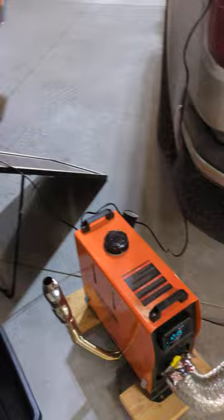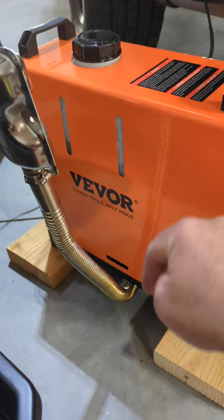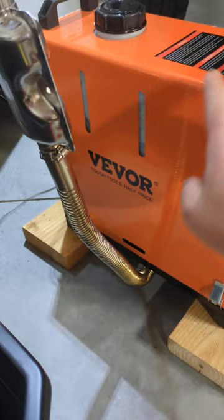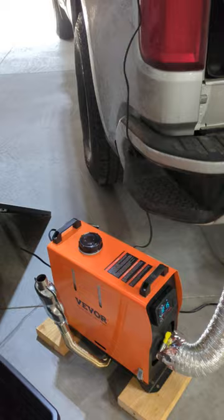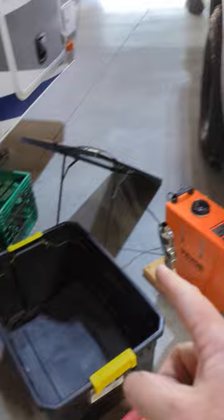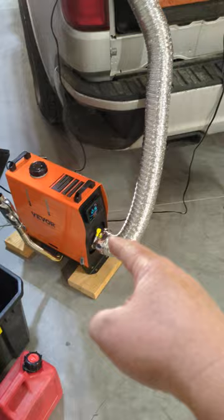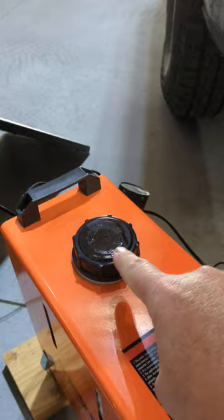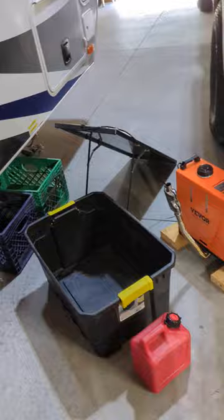The exhaust system — I wasn't really a fan of. I don't like the look of these blocks I had to put under it, but the way they manufactured it, the exhaust port points straight down and there's not enough clearance to 90 it and kick it up. I didn't want the heat too close to the diesel container and I wanted to be able to take the cover off. This is about the best I could do aesthetically. When camping, it's actually kind of stable because everything fits inside this crate. When we travel, I put the unit in here with the diesel tank, hose and everything so that in case diesel spilled, it was contained. We just got back and there is diesel on the top vent port — we were up at 12,000 feet elevation and that vent port will leak. So it's kind of nice having a towel over the top of it.